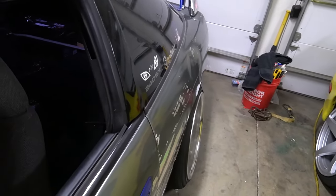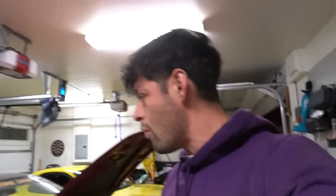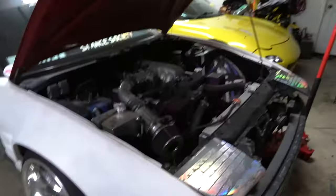There's a crazy quarter panel dent right there which honestly makes me just want to say 'yolo' and cut the quarter panels and install over-fenders, which would also let me get rid of that excess camber. I love camber and stancing out my cars, but for the 240 I kind of want it to be a little more drivable — there's so much camber in the rear that I just wear out the inner tires so fast. I want to be able to drift it and go out and slide with it, so maybe slapping on some over-fenders and taking the camber out will help.